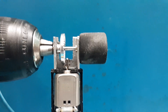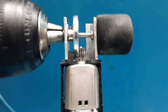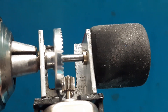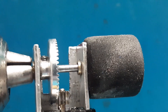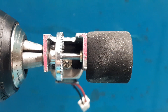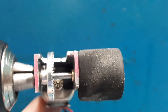I've spun my drill back and forth until it gets a nice free rotation. If you look carefully you can see some discoloration on the motor pinion gear, and that's showing me that it's working properly. You can see a little bit of debris inside there — I probably should hose it down again with some more oil and rotate it some more. But the foam tire actually rubs up against the aluminum right there, so I think I'm just going to let it be.